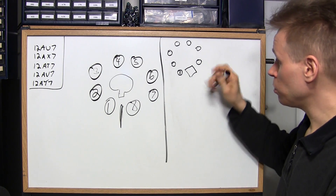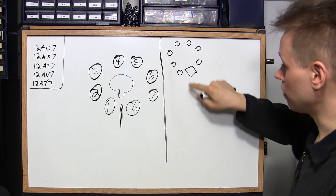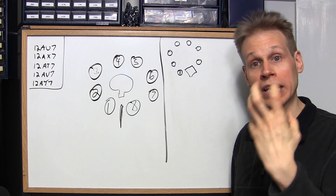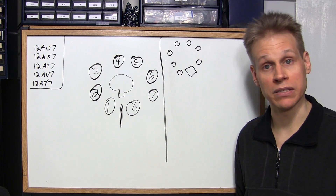On a 7-pin tube, there's an opening between the two pins and you start at pin 1 and count through to pin 7. It's the same thing with a 9-pin tube — it's always looking at the bottom side of the socket or the bottom side of the tube that determines how you count the pins.